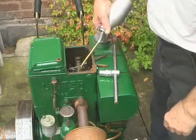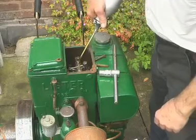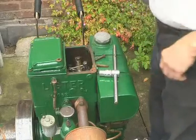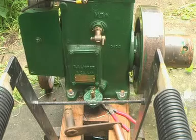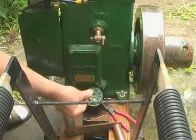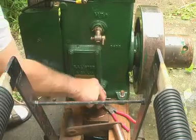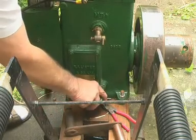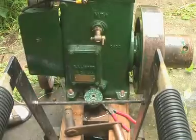We'll just squirt a bit of oil into the rockers because it's greased from a fitting on the side — you can top that up as well. To check the oil I've unscrewed it; the wing nut has studs that come out but there's plenty of oil in it. Of course the crankcase could be full of water with oil floating on top, but I don't think that's the case.